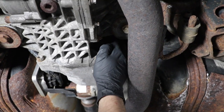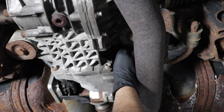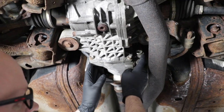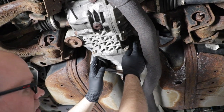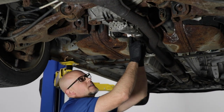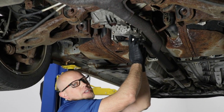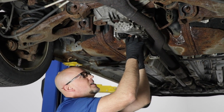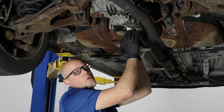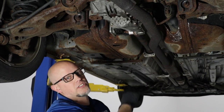To fill the fluid, you actually have to take one of the vent hoses off. Because there are all these valleys and other areas inside here, if you just fill the fluid in there, it's not going to get to everywhere. What this code is referring to is when the pump right here is trying to pump fluid to engage those clutches but is unable to engage them — it could be something wrong with the pump, or the fluid level could be low.